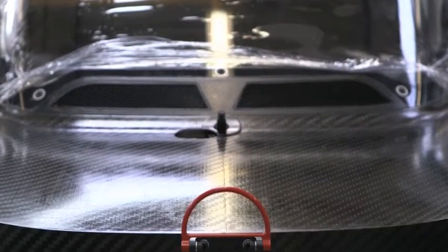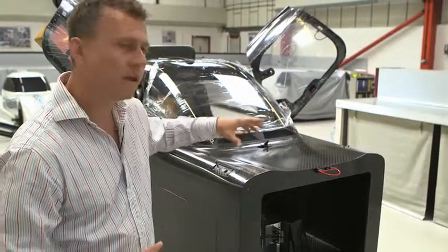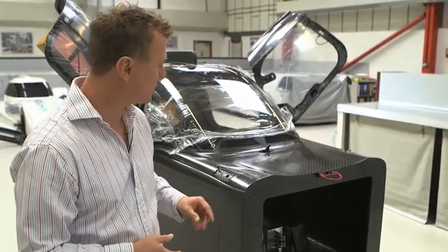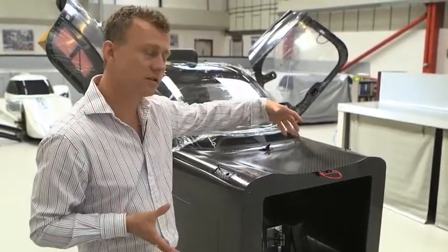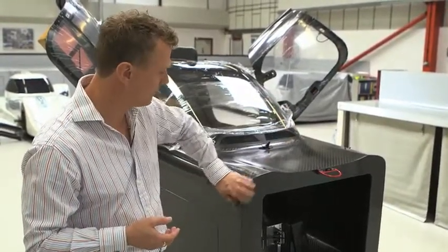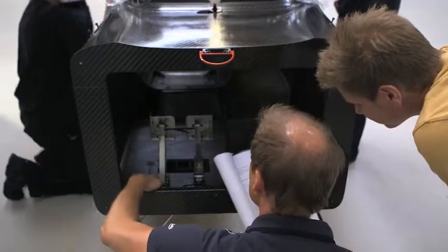There are some fundamental differences with this tub over our competitors. This section of the tub is actually quite big compared to some other tubs, and that's fundamentally because we've tried to grow this surface out, so there's no additional bodywork — this is actually aerodynamic surface. There's no clutch pedal for the driver; clutch actuation is completely handled outside of driver control.